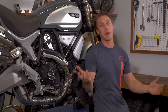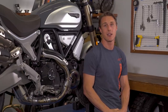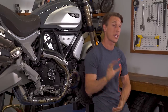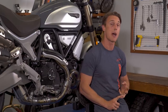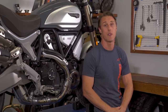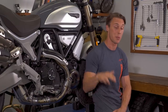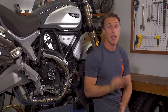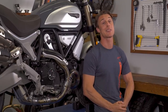And of course, there's the really big question: who needs ABS? In my opinion, if you ride on the street, it's a must. A skilled rider may still be able to out-brake some of today's simpler ABS systems when conditions are perfect, but it's not about how hard you can brake when the road is dry and clean and you are ready for the challenge. It's about how quickly you can slow down or stop when it's raining, when the road is dirty, or when your tires are cold and some fool pulls out in front of you. Emergency braking is what ABS is all about, and I find it very reassuring to know that I can simply grab that front brake lever full force and let ABS manage my threshold braking while I take evasive maneuvers. That being said, I definitely prefer a system that you can turn off.